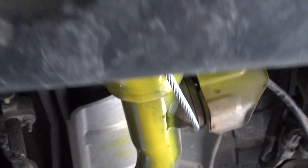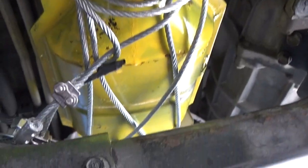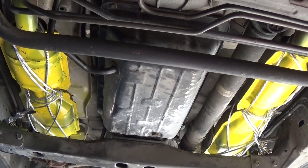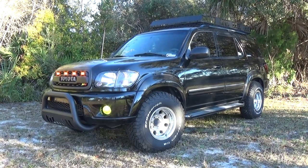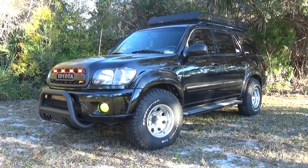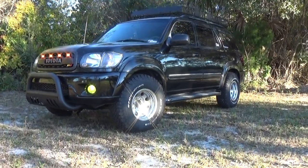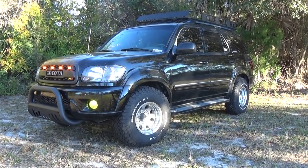Here's the cable on the back side. I have the driver side and passenger side all secured now with the cable. Here's the driver and passenger side of the cats — have the cable on them, bolted up, looking good. I would like to do a step three. I've been trying to locate a skid plate with added catalytic converter protection, but it looks like everything's out of stock or not available anymore. If anybody knows where to find one, I'll gladly install it on the Sequoia so we can all see how it's done. This completes step two of the catalytic converter deterrent — hopefully this helps protect your Sequoia from catalytic converter thieves. They're going to get under there, see that mess, and move on to the next vehicle that they can remove cats from super easily.